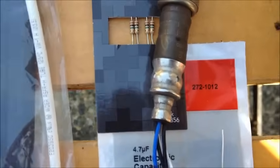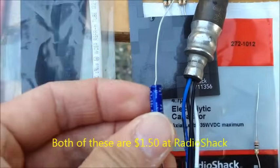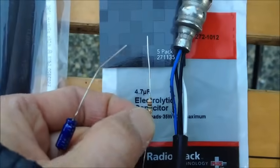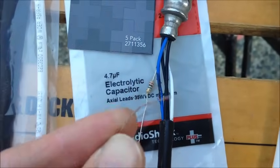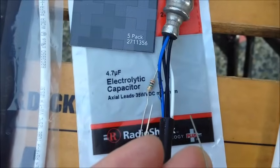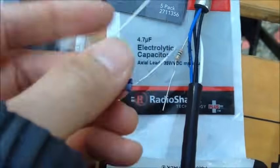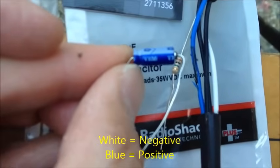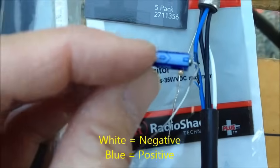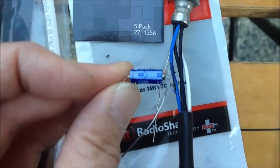So again, here are the parts — a one megaohm quarter watt resistor. I'm going to put this in-line with the blue wire here — that's the signal wire. And then after the resistor, towards where the computer is, I'm going to connect the blue wire and the white wire. It's very important you do it on this side. I've seen pictures of people doing it on the other side — that is not going to work. Also, the capacitor must be oriented the right way; each manufacturer is different. On this one you can see there's a little arrow on the white stripe, and that arrow has a negative on it — so you want to point that arrow towards the negative, or the white wire.